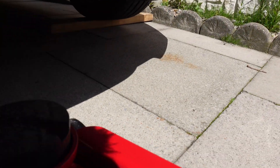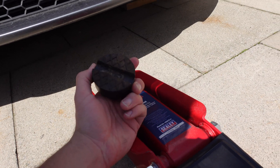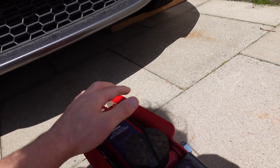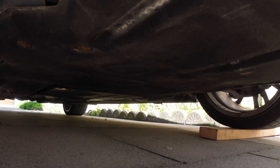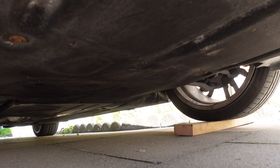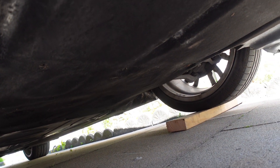I wouldn't run the car right up to full temperature because then when you drain the oil you run the risk of burning yourself because it'll be so hot. I've just done it for five or ten minutes — it's like a quarter of the way up on that dial. Also get something like a rubber pad so that you've got a rubbery thing rather than just the metal of the jack going up on the car. You need to find the centre jacking point, which might be easier to show you once I've jacked the car up.